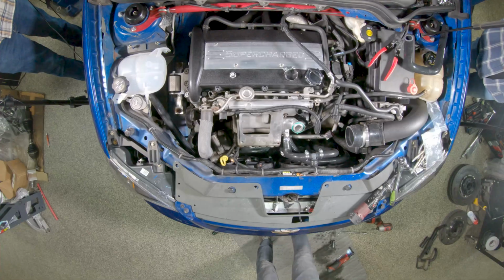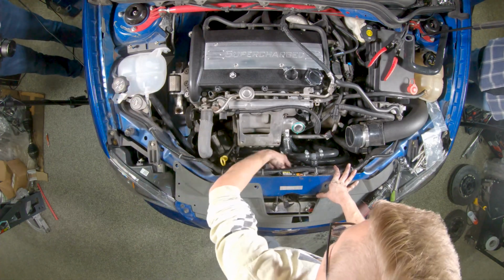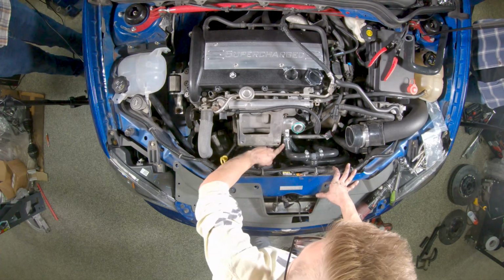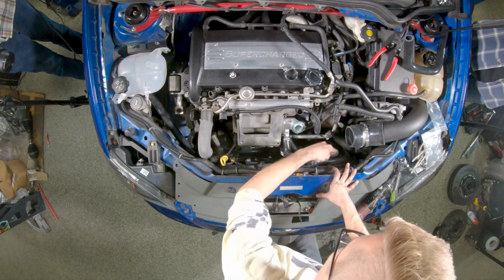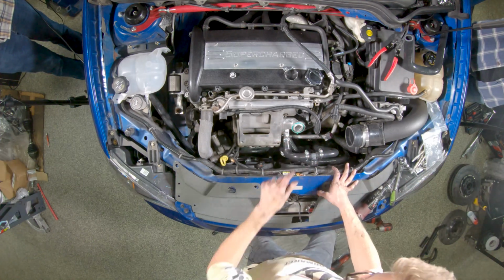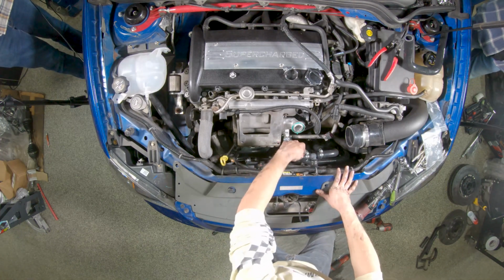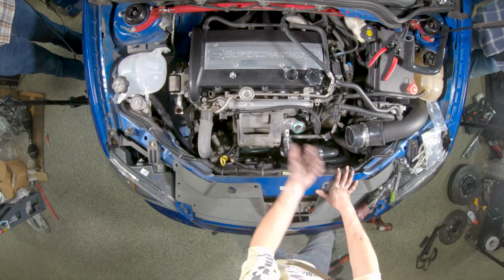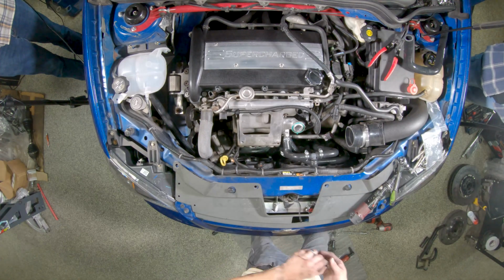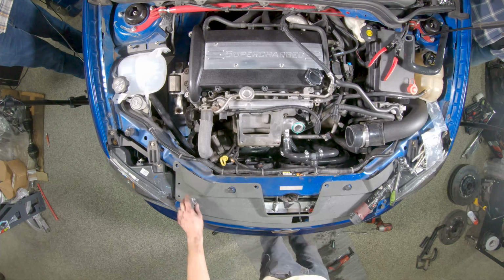Now the reason we do this routing is your option B is filling, so it's coming across here. It's meeting this T from the outlet of your dual pass. So it's flowing this way, everything's going to flow and it'll go down into the pump, then through your heat exchanger, back on up. Air rises up, so you want this to always face up. I know some people have flipped this and gone the other way. It's not going to bleed quite as well. So we're going to pop downstairs, attach that last clamp, and then we'll be good to put the blower back on.